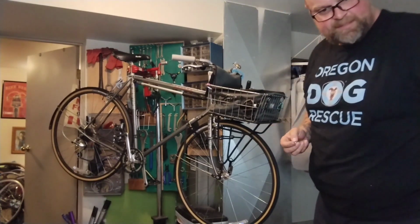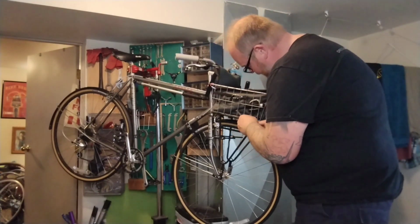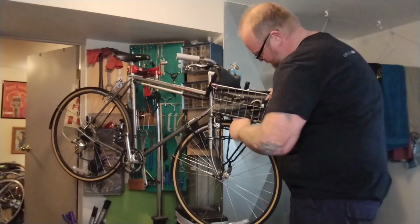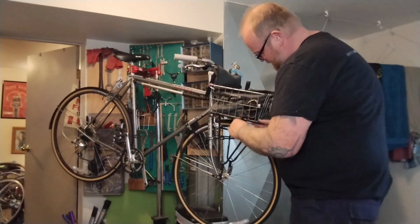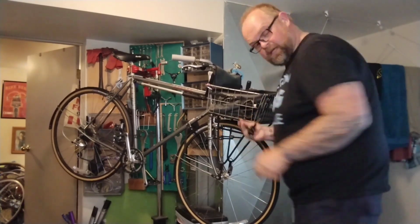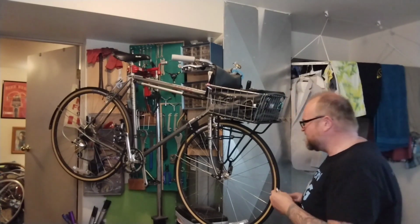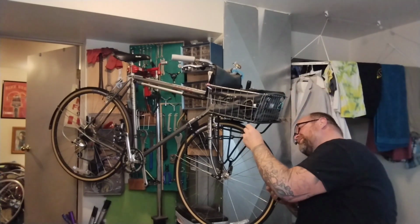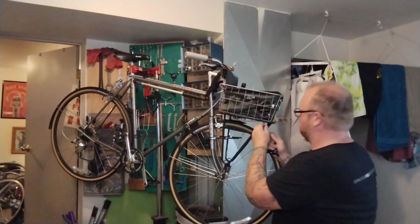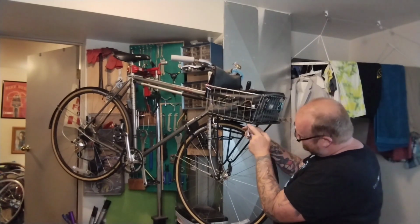Let's try it from the front and see. Sometimes a nice old hard bolt going through, if something's a little dirty, will clean it out just as good as a tap. Yeah, this bolt's fine. Doesn't need a tap. Just run this through a little teeny bit. And sometimes when things are being weird, you just need to get down and use your eyeballs. Really look and see if there's something else going on. God, it looks like it might just clear. Nope. It hits the rack.